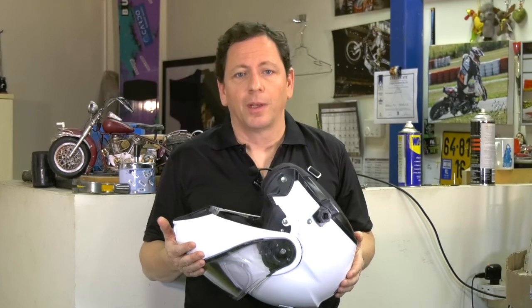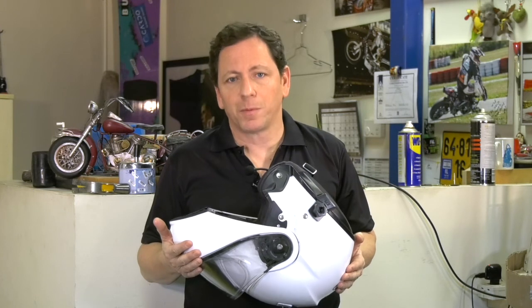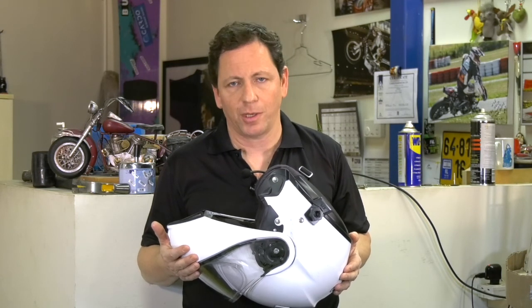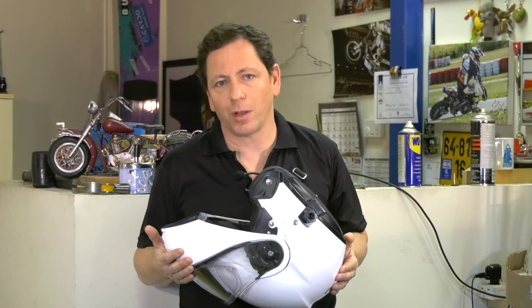You're riding down the road and the sound experience is not exactly what you've expected. Well, there's a solution for that. Let's see how. All Freecoms come equipped with high quality, high definition 40mm speakers, but to get the most out of them, they have to be placed correctly, like this. Every person is different, and your helmet's designated speaker cavity may not match the location of your ear. Put the speakers in your helmet, put your helmet on top of your head, and try to slide a finger inside and see if the speaker's location and your ear location match. If they do not, you may have to place the speakers outside of the speaker cavity to ensure best sound quality.